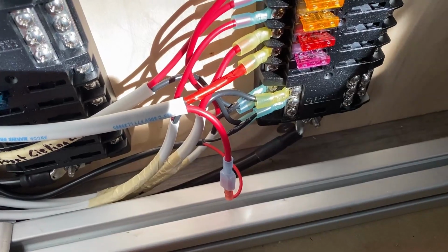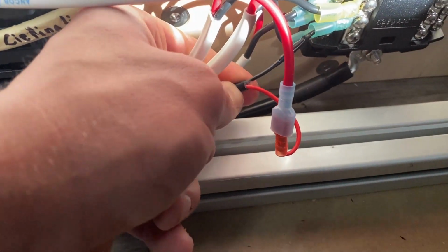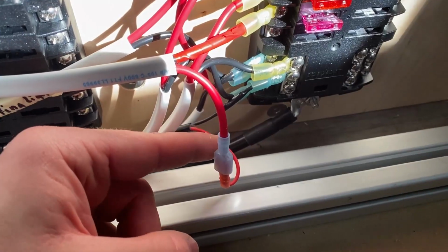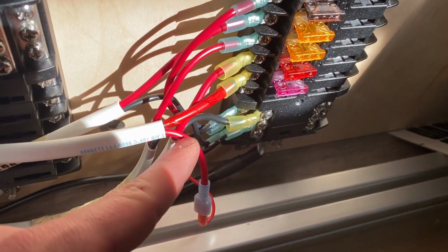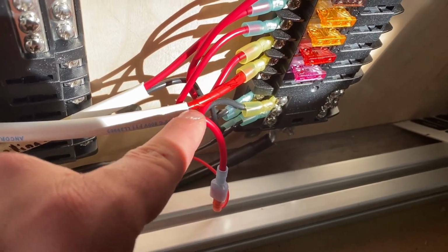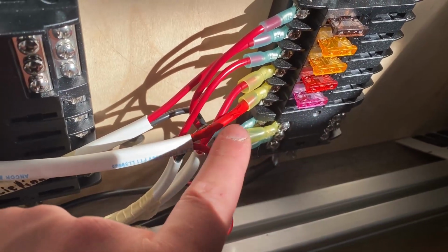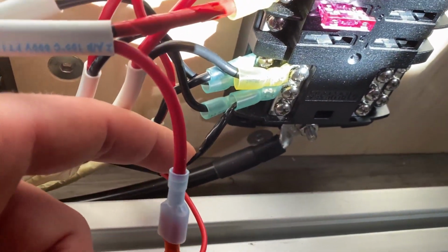That switch for our cell signal booster is the most basic version of a switch that you could possibly have. The way that it is run, this black wire is the wire that connects directly to the cell signal booster that came with it. I cut it down and stripped off the two ends. Instead of attaching the positive of the cell signal booster to the 12-volt fuse box directly, I took the positive, routed it to this cable, which I have back to the switch. This intercepts the positive. This goes to the switch, all the way back out, and the other side of the switch is attached to power, so that when the switch turns on, we get power through this wire and up into the cell booster. Then we just have the ground cable, which is this one right here. Same as all the other ground cables.